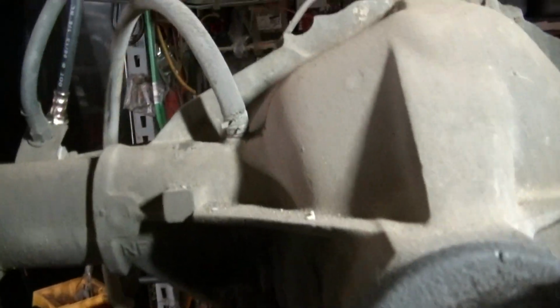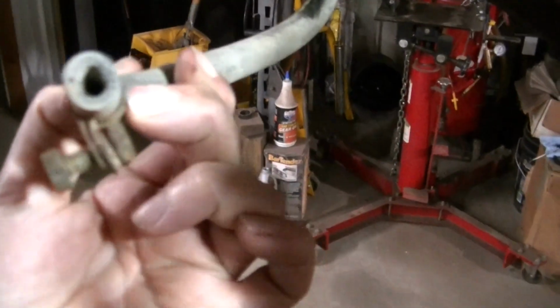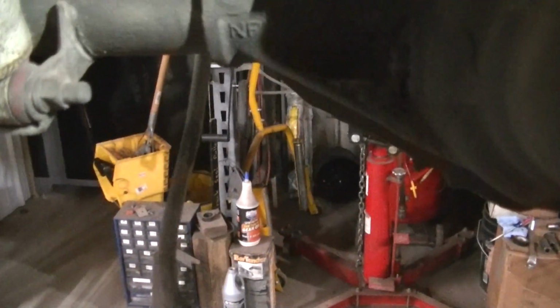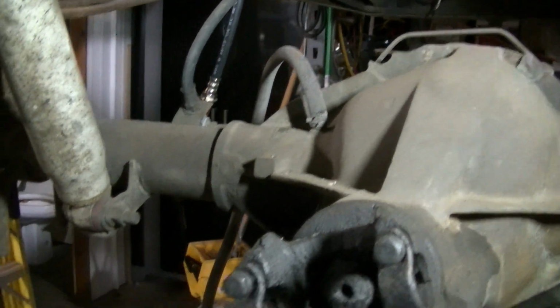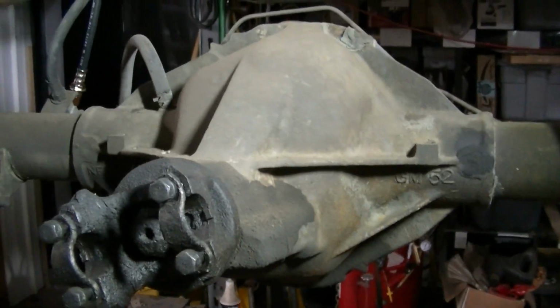all nice too. Again, I got to do the vent hose. I mean, you can see what they got in here. Actually, there's nothing in here, so water and anything, dirt, bugs can crawl right into the axle. So it's about ready to rip off anyway. So I'll put a new hose on there, get it bolted up, get a nice vent top so stuff can't fall into it. Get some new fresh fluid in the rear axle. But yeah, this is the bottom side, guys.